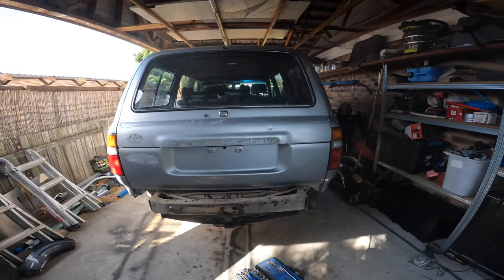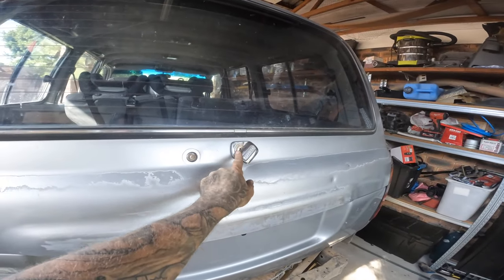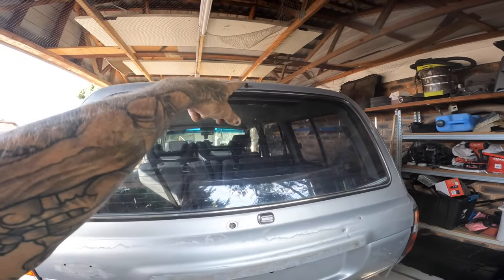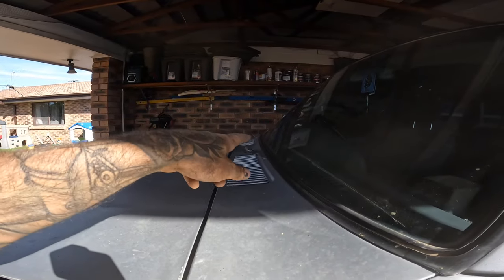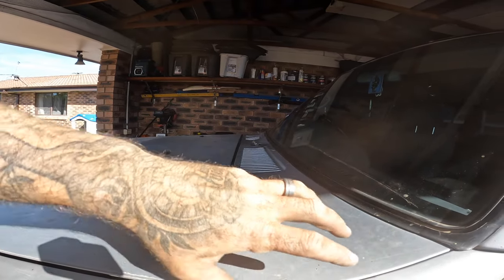Jenna's just on the other side scratching all the glue off — people are probably going to hate the sound of this. Yeah it'll scratch the paint, but we're going to sand the whole car anyway. Got that decal off, got the rear wiper off. That one will stay because it's the key barrel — can't be bothered to mess around with it so I'll just tape around that one nicely. Same with the washer at the top. Going to take the bonnet off in a minute, front wipers are gone, and then I'll take this panel out so it gives me a nice edge to paint to.